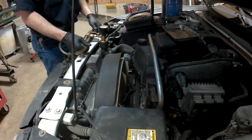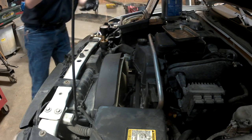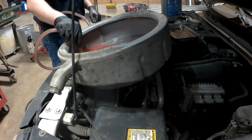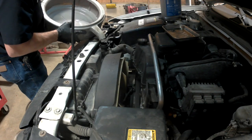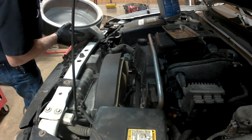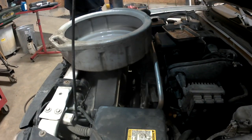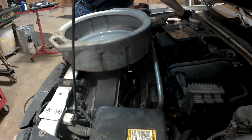Wrestling those clamps back on — be careful as you release them that you don't put your fingers under a radiator mount. I'm using an air lift to fill it up — it's less mess and I get more air out of the cooling system on the first try. Once I air-lift the cooling system and pull a vacuum on it, it'll suck coolant in and everything is good to go. I'll hose off the front of this engine with a garden hose before I start it, so once I test drive it I can see any leaks — coolant will leave a residue even if it evaporates.